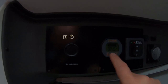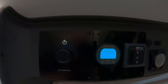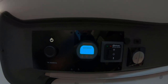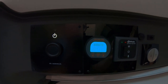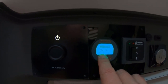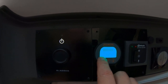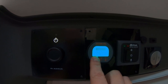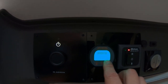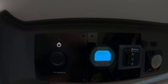I've put as many devices on as I can - fridge on, TV switched on which brings the current up a bit more, all the lights in the van are on. It's showing 8.4 to 8.5 amps, with a negative sign showing that we're actually putting current out of the batteries rather than in - so we're discharging. If I push the percentage sign now you can see it's dropped to 99.9% and over time that will start to drop as I use more power.